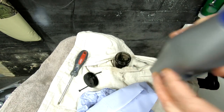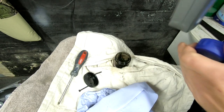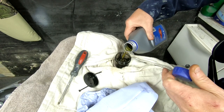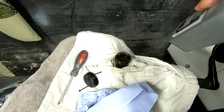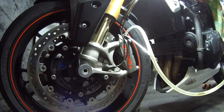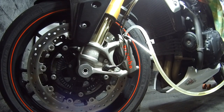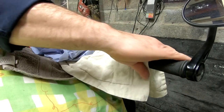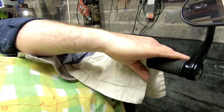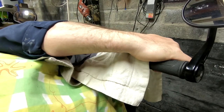I like to write the date on the top of the bottle of when I opened it. With the bleed bottle and siphoning tube connected up, I'll crack the nipple to make sure it comes apart. At the brake lever end I've taken the reservoir cap off — I want to make sure I can reach the lever so I can pump it when I open the bleed nipple.